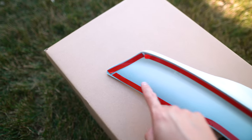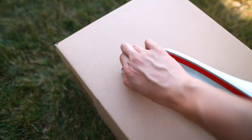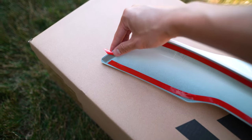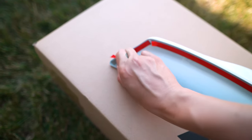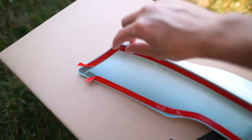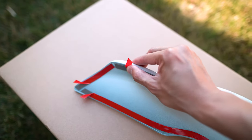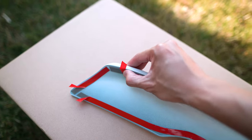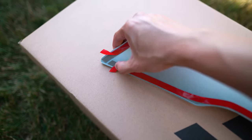What I don't do when installing things like this is peel all the backing off the double-sided tape. What I suggest you do is just peel a little bit off one of the corners, and then fold it out to an area where you can pull the backing off when you have the piece aligned where you want it. That way you don't just stick it on there and then it gets stuck where you don't want it — just a pain in the butt. Just peel off a little bit and create a tab for yourself to pull the rest off once you have the piece on the car. I fold it over like an ear, so it stays pointed towards the outside and we can pull it once we get this placed on the car.